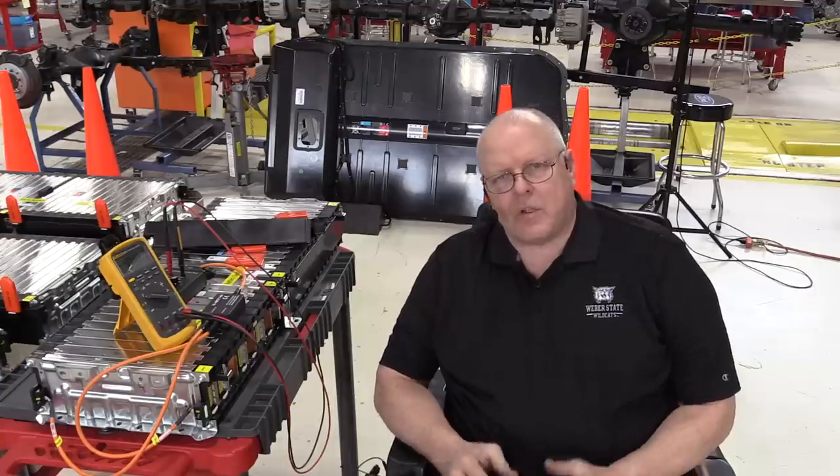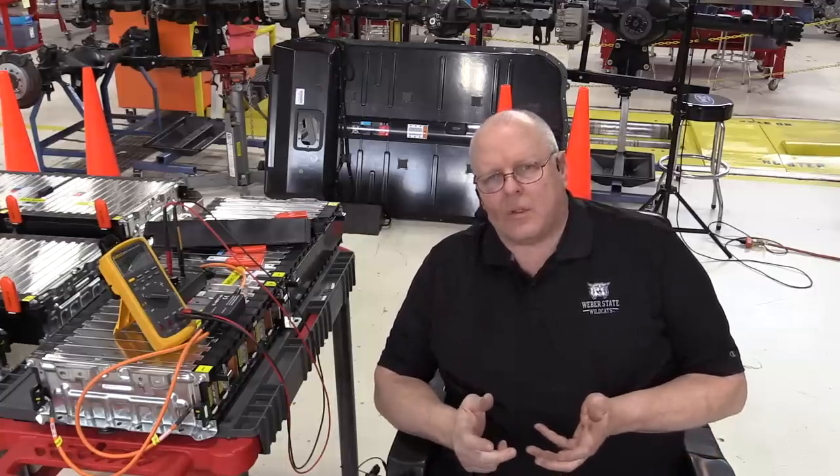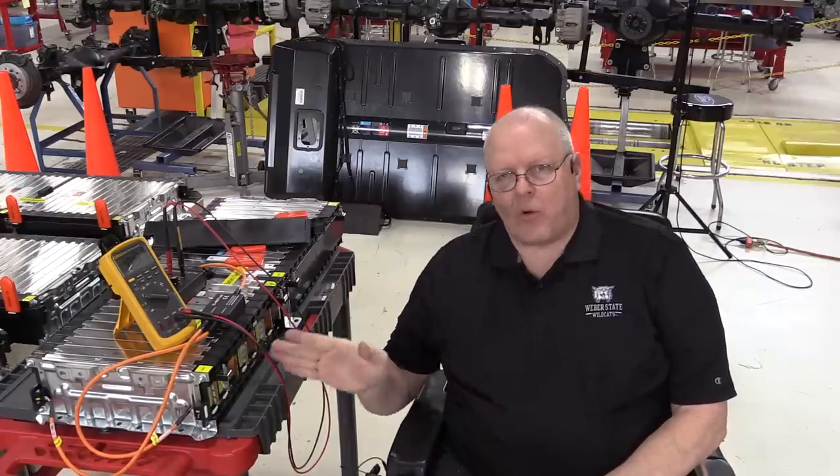Now, of course, you can read those voltages on the scan tool, but this is part of a verification process that you would go through if you had a diagnostic trouble code that you were following through, because maybe the voltage that you're reading on the scan tool was incorrect because of a poor electrical connection or an open circuit or something between the battery energy control module and the electrical connector here. So you would verify what the voltages really are at the battery versus what you could see on the GM MDI 2 scan tool. Before we put the covers back on this battery,